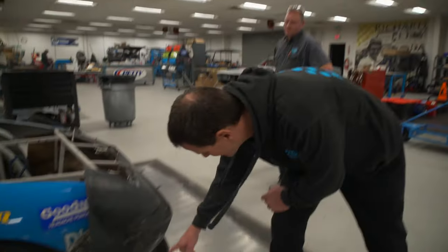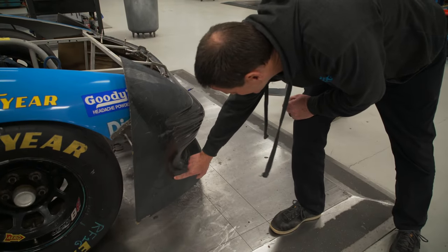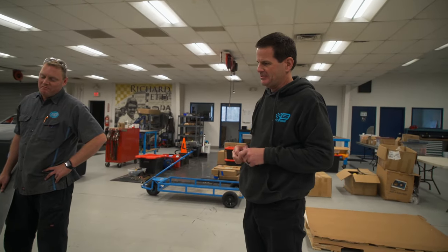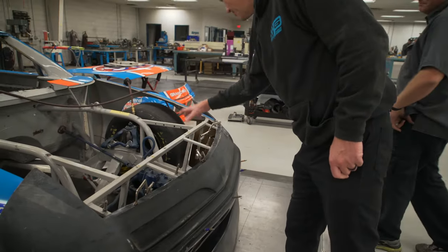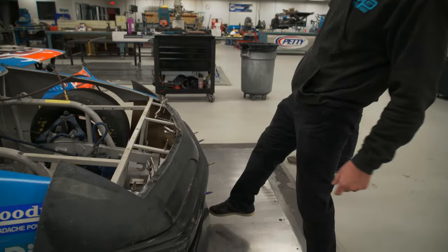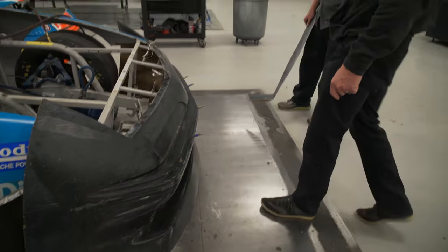I remember on Pontiacs, we cut this back and scalloped it even further, which made it more like a splitter that went further around the corner. Did that for a while until they got onto that. We added 3 inches to it, so it would be the same length from the 10-inch mark to the kickout of the other makes. That's how they start equalizing them, because the Pontiac was such a shorter car.